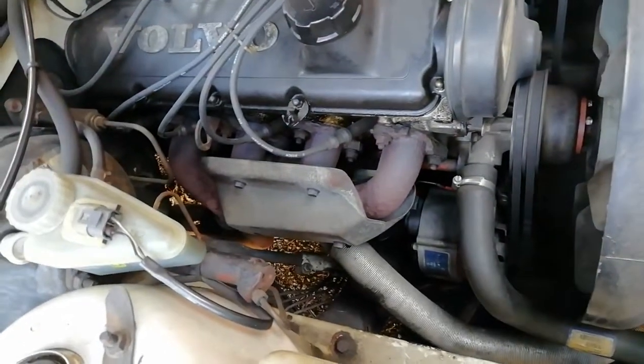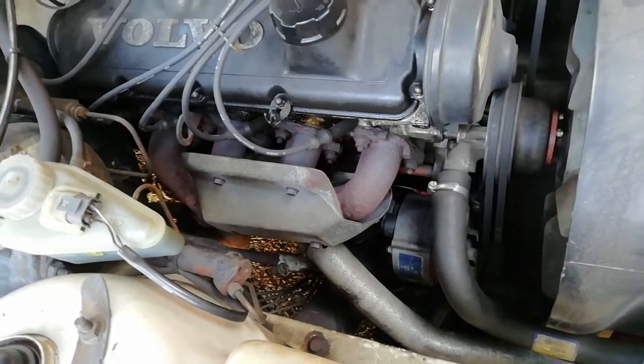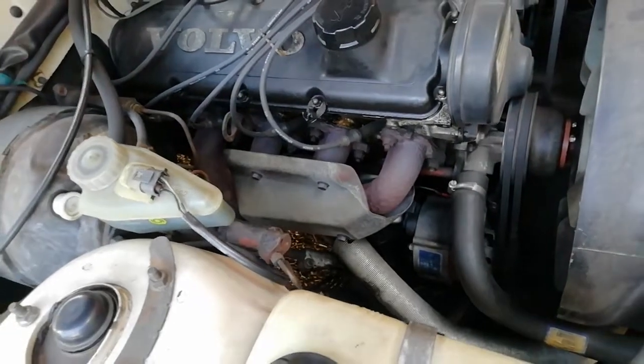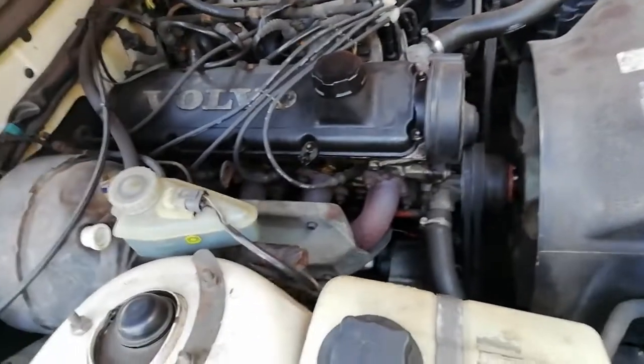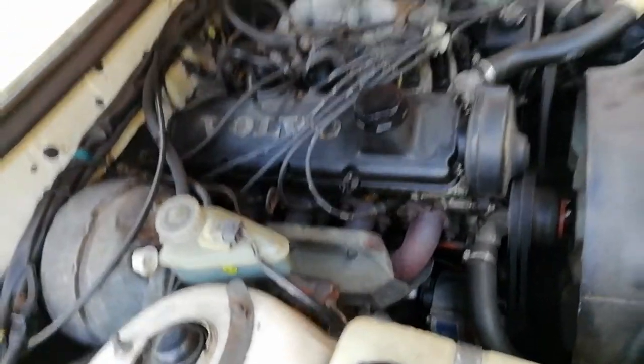This is the famous Torslander, which has an alternator failure — or, strictly speaking, a failure of the brushes. They didn't wear out; one of them broke in half and fell out. I changed the whole alternator, then realised afterwards I could have just changed the brushes. But anyway, it's back in operation, and I've got a spare alternator, which is very nice.